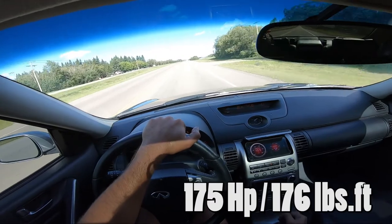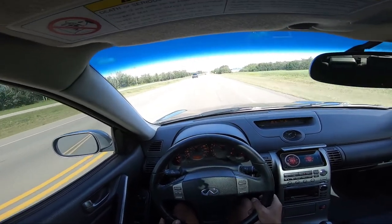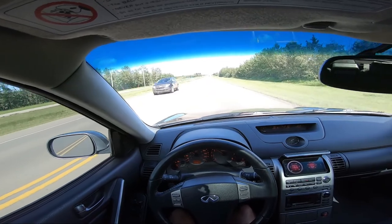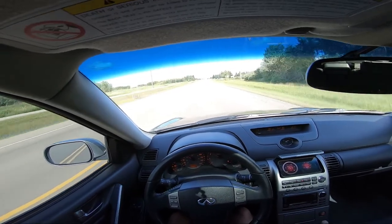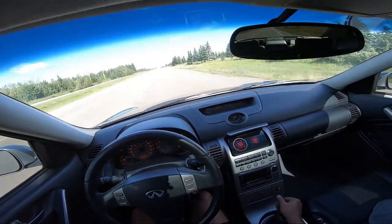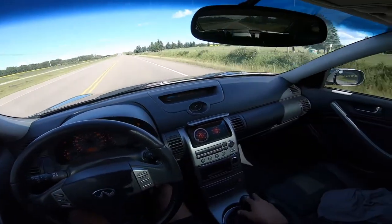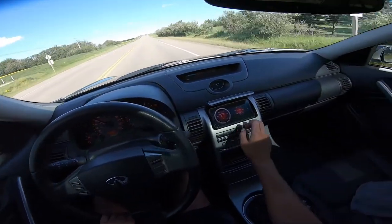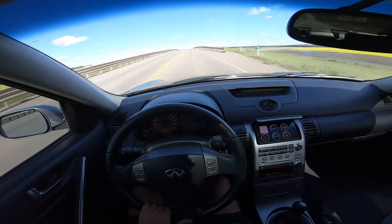So that's only showing peak torque at about 176 pound-feet of torque. These cars have substantially more torque and power than that — I believe they're in the mid-200s for the VQ35DE engine which is in this one — so that's not a gain at all in power. Although the power delivery did seem pretty smooth, stepping on it right now the performance feels very similar to the way it was initially. The CRC throttle body and MAF sensor cleaner doesn't seem to be doing anything different to how this car is feeling, and the numbers on live data are kind of indicating that too.